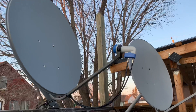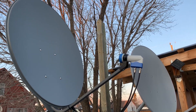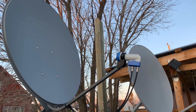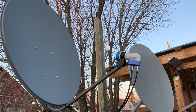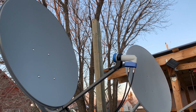It's important to remember that no matter how many satellites and transponders you enter, if your dish is not aimed properly, you're not going to get any channels. So get your dish set up as accurately as you can before you start. Once you get going you can always tweak the dish a bit, but it's a lot easier if your dish is aimed properly first.